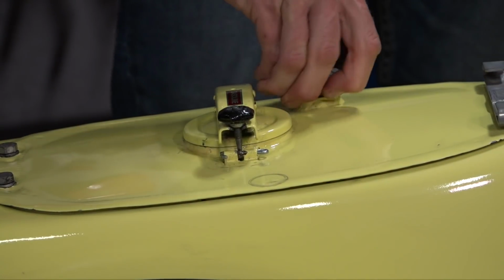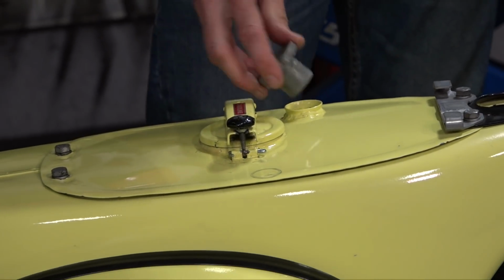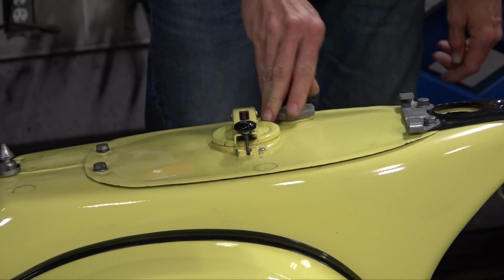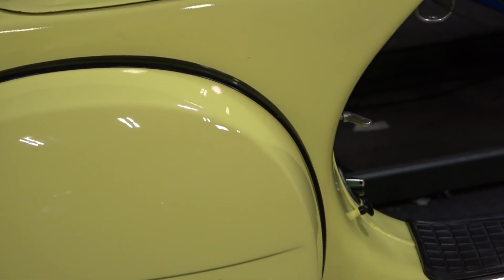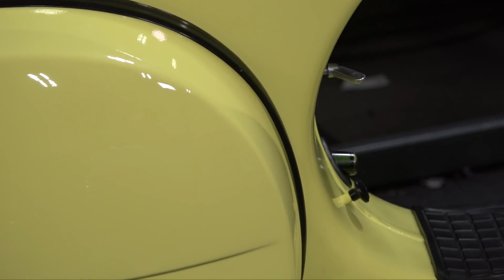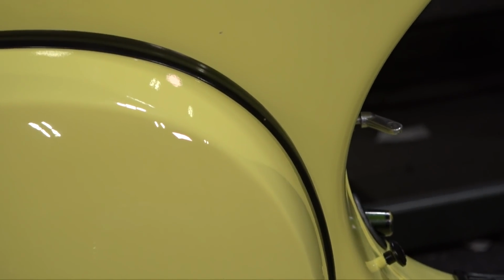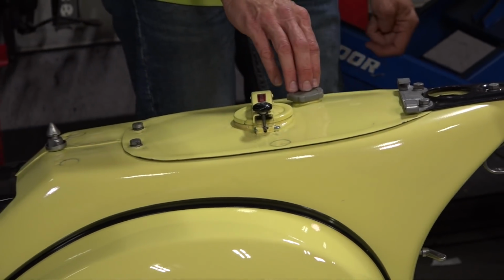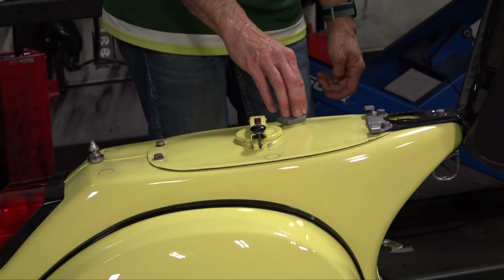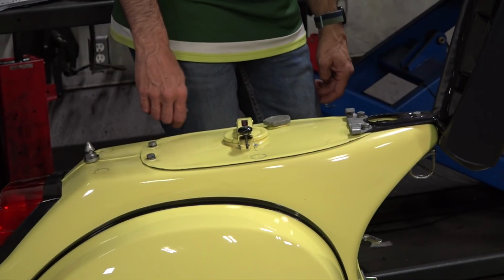You got your oil tank right here. A lot of people don't understand how the oil tank and the indicator works on a vintage Vespa. They're always just topping it off. You wait until you see the sight glass where it shows the white indicator, and at that point you can pour a whole liter or a whole quart of 2-stroke oil into this tank. And I would say it's about 500 miles, 600 miles is how often you got to top off that 2-stroke tank. Very convenient versus mixing it into the tank every time you stop at a gas station.